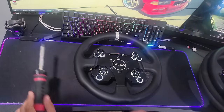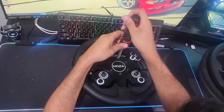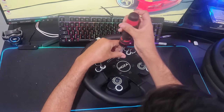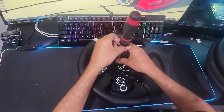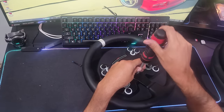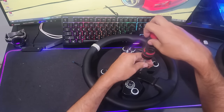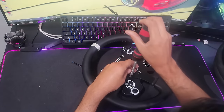It's a very simple process, but I'm very curious to see if it's going to make a big difference. We do have to take these six screws out of the top of the wheel — make sure you are careful because they go straight through the wheel into the quick release. They are extremely long screws, and they have Loctite on them so they are a little bit tough initially. I would be better with an electric tool, but I'm trying not to strip any of these out.